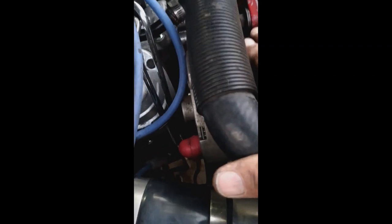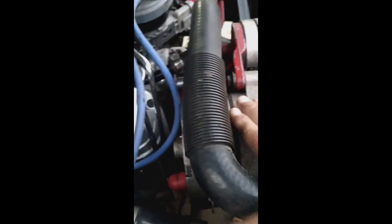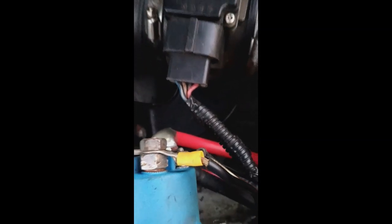The reason being I have a one-wire alternator. Get you one of these — it's something Racing, 140 amp. There's a little red cable down there, you can barely see it. It sneaks right up through here, real short, comes right here. Also the starter of course is over here, so there's two starter wires going to the starter there. They were real easy to deal with — I just disconnected them and pulled them up through this hole here, attached them. That's it. My main cable right here goes down through here and is attached up under here.